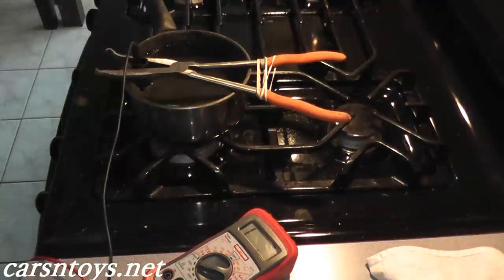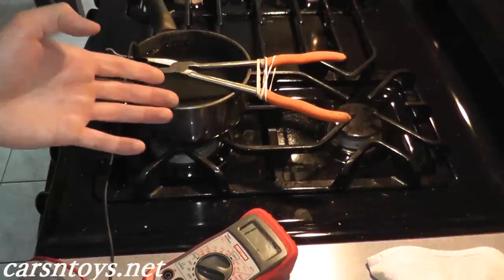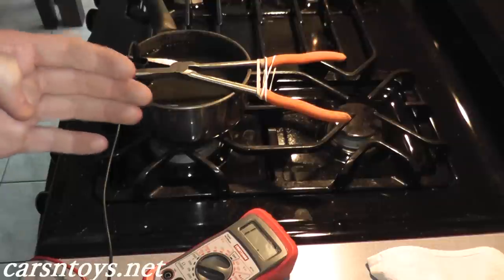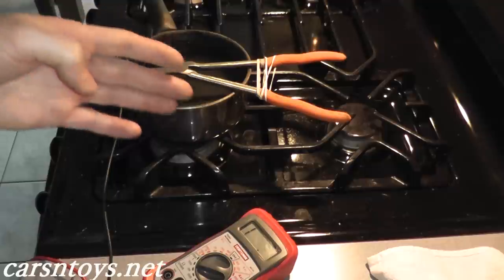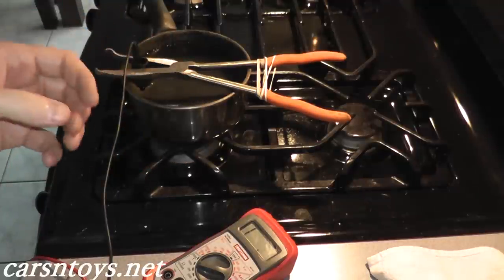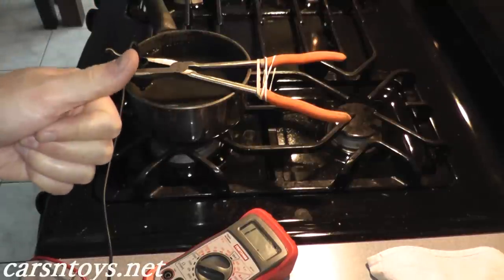On this vehicle, 0.3 kΩ corresponds to around 170 to 180 degrees water temperature, so you don't want to let it get that hot — don't boil the water. As you can see, this is a very simple test that pinpoints whether the problem is with the sensor or with the harness connector. Once you diagnose where the problem is, make the repair and you'll be in good shape.